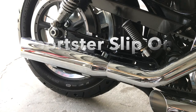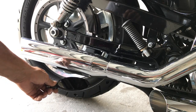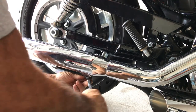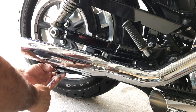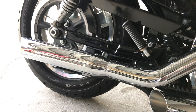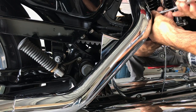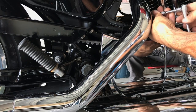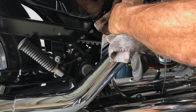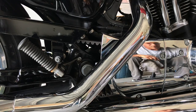With a half inch, you will see two nuts on the bottom. Now we're going to remove the shield from the exhaust. Put a 5/16ths socket — there's two of them in the rear and three in the front. We need to remove this chrome cover. I like to take a little penetrating oil and just spray them in here so we don't break them, and it makes it easier. I just did the front and the rear.